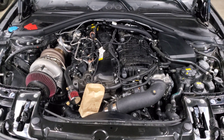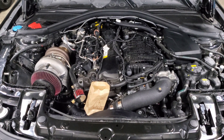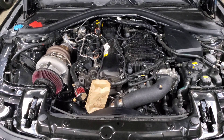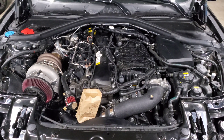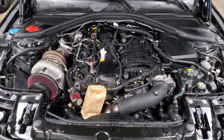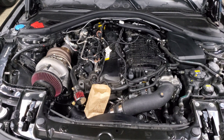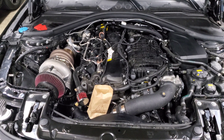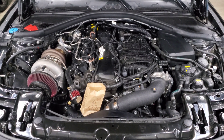The primary limitation of hybrid turbos is horsepower capacity. Options for the B58 are generally capped around 700 wheel horsepower — they just don't have the efficiency needed to run more than that. With the stock-size runners, you lose efficiency quickly when really pushing for higher power. Most of these turbos are really happy around 600 to 650 wheel horsepower, though I've seen a couple dynos where people add port injection and push hard to get into the 700s.